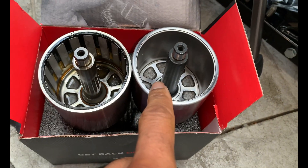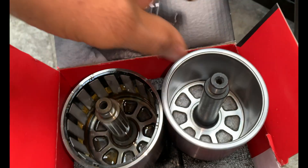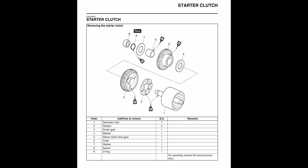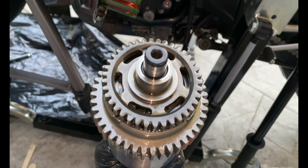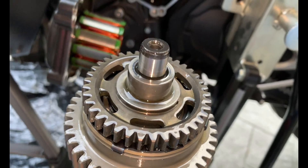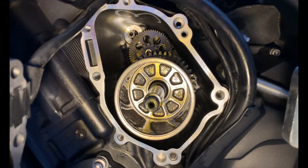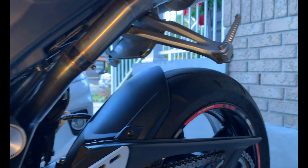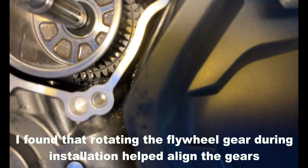Also, whenever you install the new upgraded version, check for loose debris inside — I did find a few little metal flakes. So I'll clean it up and oil it up right now, then reinstall. I got everything assembled and oiled up really well. Now I'm just going to take my time and slide it back into the bearing. One of the easiest ways to get this done is to rotate the gears — I was rocking the back wheel back and forth and that didn't work. You can see the teeth are actually meshing with the lower gear and everything just slides into place.